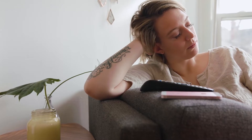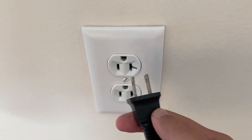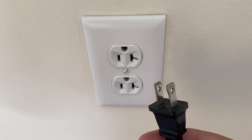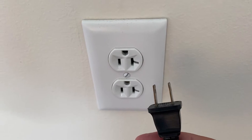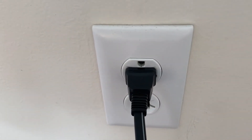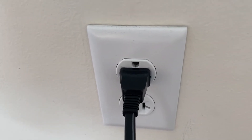Let's see if we can fix your problems and get your Disney Plus back up and running as quickly as possible. The first one is the easiest one to try, and that's to unplug your TV from the wall outlet and wait 60 seconds. Don't be impatient here — wait the whole 60 seconds, then plug it back in. This is very different from turning your TV on and off with your remote control. This is what we call a hard reset of your TV, so make sure you do this method.